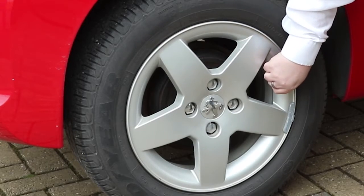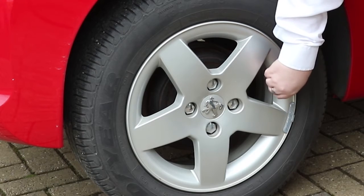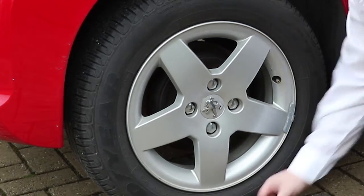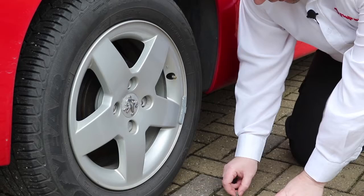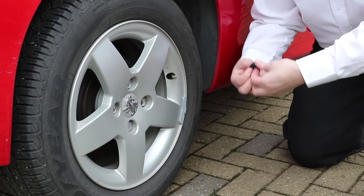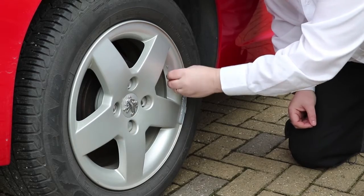So you simply need to remove the dust cap. These sensors come with a dust shield which helps prevent build-up of road dirt around the sensor. You then turn the dust shield inside out, place that over the valve, and push it down as far as you can go.